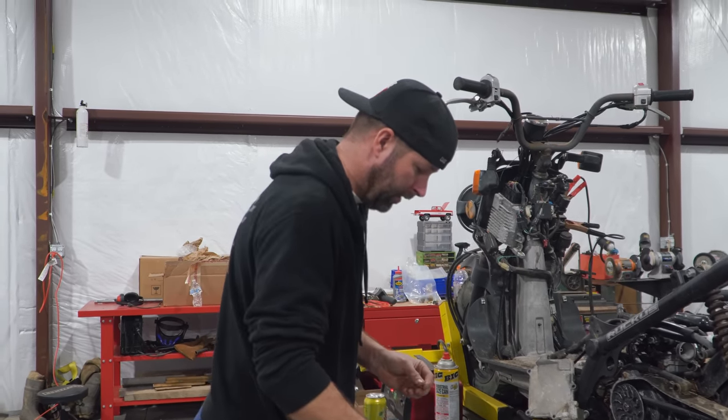There's plenty of room under the seat for us to mount something. Mount a bottle. Okay. And this fuel tank is just junk. The fuel tank has some holes in it and it's very crusty on the inside. We can't rely on the fuel pump. It works and then it doesn't work. So I think we're going to do the good old Gatorade under the seat trick with the fuel line going to the carburetor. And maybe we can do some riding with that.